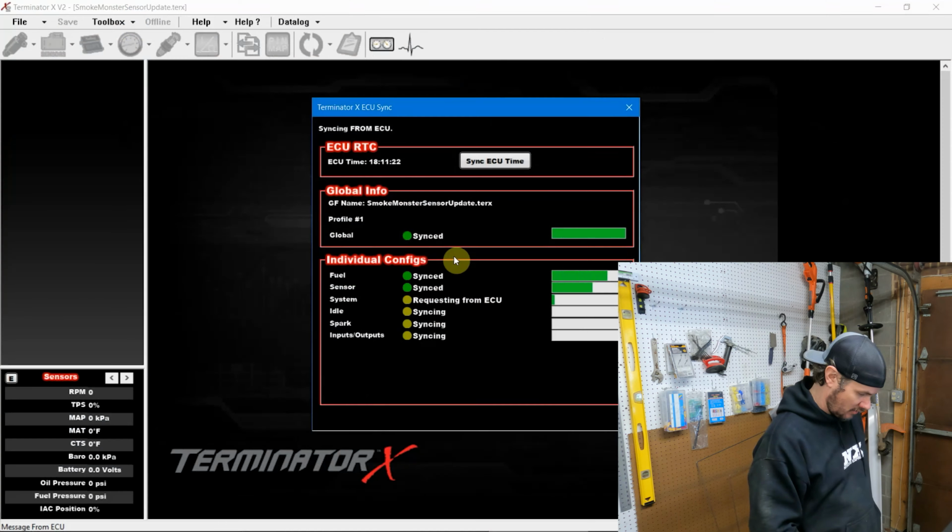So it gives you the ability to see the adjustments that the closed loop is doing. They're technically two separate things that are working together. Closed loop operations will make corrections on the fly, learn logs those corrections into a table so we can see what's going on. So let's get the laptop set up and take a look at it.